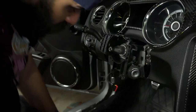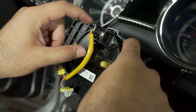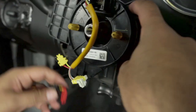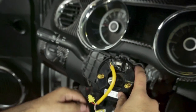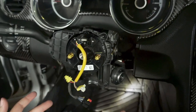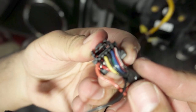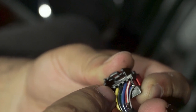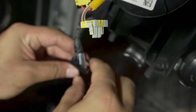After you get that removed, you're going to see the clock spring — it's going to be connected right here. Here's your factory clock spring; it goes in like this and bolts on at two points. So one connector from your steering wheel is right here, and the other connector is down there. Now on this pin connector there's an empty slot next to the yellow and red wire, and there's an empty slot right next to the purple and blue wire — this is a 5.0 but they're all pretty much the same.